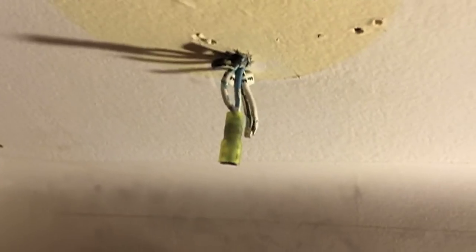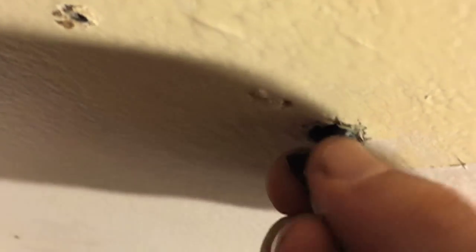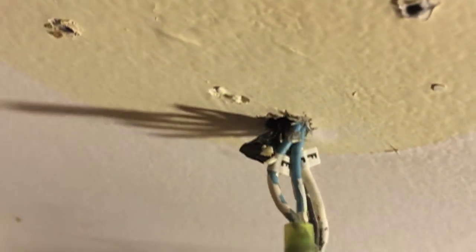I'm renewing a nav light here on the nav desk. I see some electrical tape coming out on the connectors, and I'm worried that Hunter did a lousy job. I can't even get a good look at where they did the splice. Hunter uses this nasty gooey putty that seems to have broken down over the years to hold their wires in place. I'd like to mount a fuse block here in the battery compartment, but I don't know exactly what's behind here — I'm aware you can't just be drilling holes willy-nilly into any surface. So we're going to try to take a look back in there.